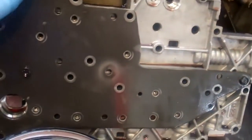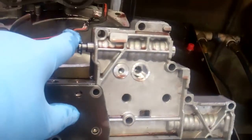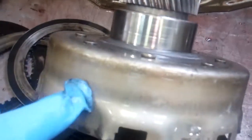This is your valve body assembly — you can see just the metal right there just where I've wiped my finger. It shows where the metal and debris is going through the system. You're going to have to redo the PR valve. The valve body needs a snap ring kit. And then we've got a sun gear shell here — if you look real closely, you can see right here where it should be straight down and where it's cut into, and that's happening all the way around. You can see it again right there where the shell is rocking back and forth and it's just beating that metal out, causing excessive end play and wear. So we're going to have to replace this sun gear and shell assembly as well.